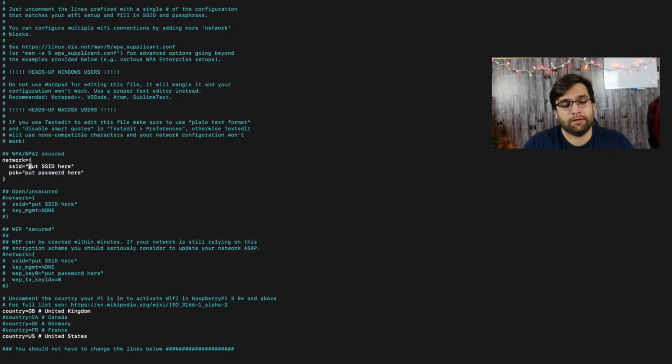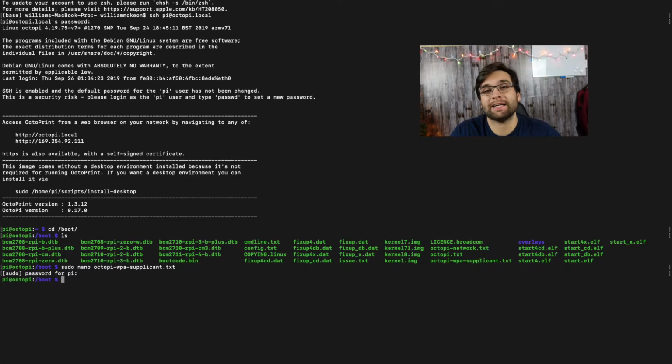All right. Then we're going to come up to here, and we're going to put in our Wi-Fi network name. Well, that doesn't work. I forgot. And my network is Islander, I-S-L-A-N-D-E-R. And my password, sorry to say it to all of you, but you're not going to see it, so I'll make the changes to this password. And then to get out of this file, Control X, hit yes, and then hit enter. And that's all you really have to do.